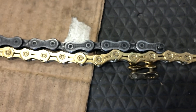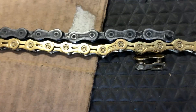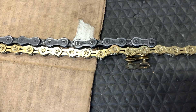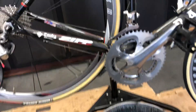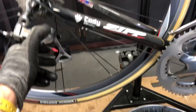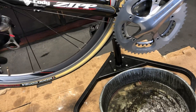From my demonstration you can see that at that point the chain would end here, and the current chain ends here — so it's about half a link difference, which is fine. The chain that was on there had a little room to play, so I can take out a tiny bit of slack. The only issue with a too-short chain is if you're in big-big, the derailleur would be stretched way out.